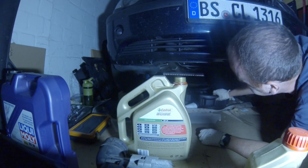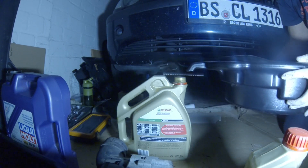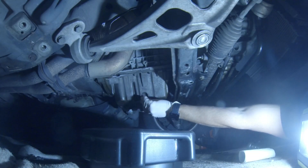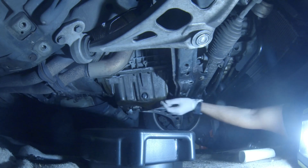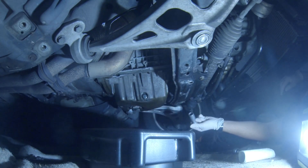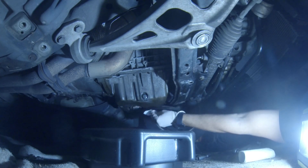The engine oil should now be completely drained. Time to get rid of the old oil — fill it into a safe container and think about the environment. I am putting the drain screw back in place. This is where part one ends. The next video, part two, will cover removing the belts, the pulleys, the alternator, and the oil filter housing. For more details about these videos, please refer to the description below. Thanks for watching and see you next time.